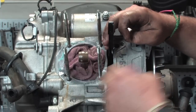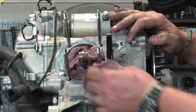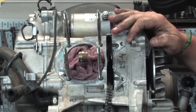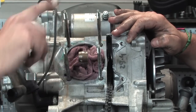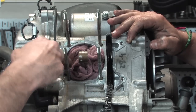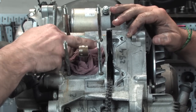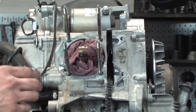I think it's time for me as the grunt to start cleaning the rest of this gasket surface so we can get ready to start reassembling everything, right, Robot? Correct, yep. And basically clean the surfaces of these studs. You want to carefully scrape all the remnants of this gasket. Do it with an X-Acto blade or a straight edge razor. There are special gasket scrapers to do that.